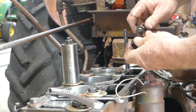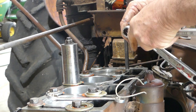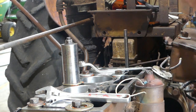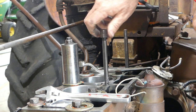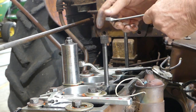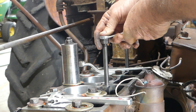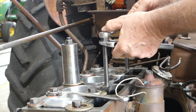Don't do this job until you're ready to put the head on. Put the studs in and then get the head — try to put the head on in the same day or the same process. You can see how easy that is to screw in; that's how it should be. If it goes in like that, there's no burr on the threads.